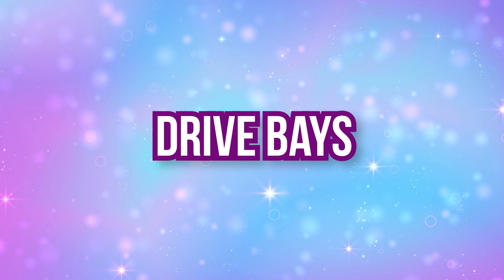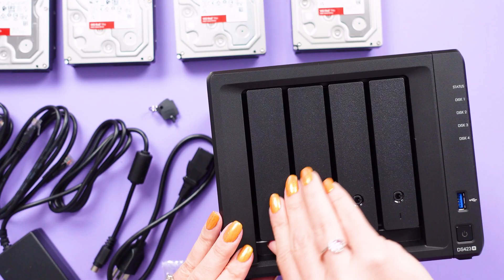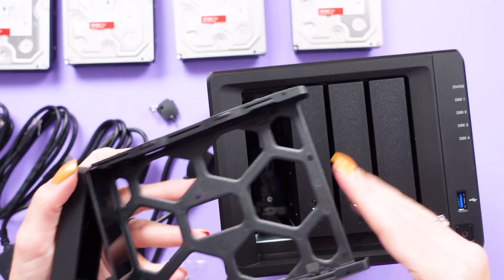Scalability is also important if you expect that you may need more storage in the future. Some NAS boxes allow you to add an expansion unit to easily add more storage without having to buy a new NAS. How many drive bays are available? For me two is fine, but I went with one that has four. I always need at least two so that I can do a RAID setup. Some RAIDs need three drives to perform. I usually just use RAID 1, which mirrors the data across two drives. This time I went with RAID 5, so it's slightly different, but I still need multiple drives to make that happen.